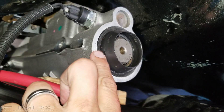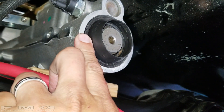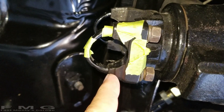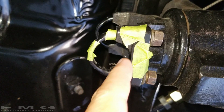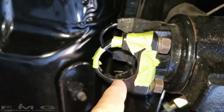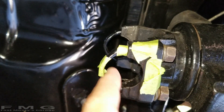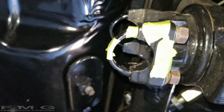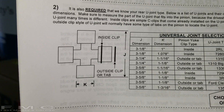According to the instructions, you measure from the machined surface on the transmission to your rear differential — specifically from that machined surface to the middle of the yoke, the round piece that you stick in there. I'm going to go ahead and measure that, document it, and move to the next step.